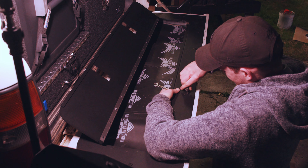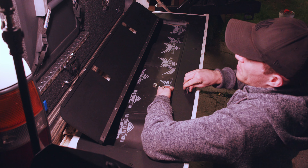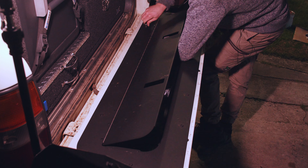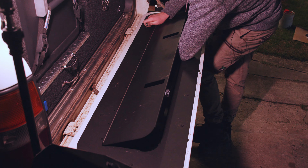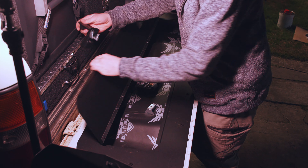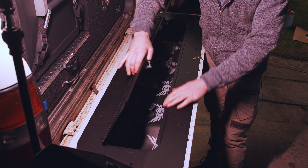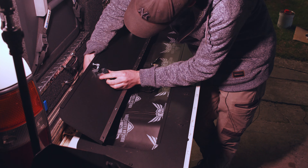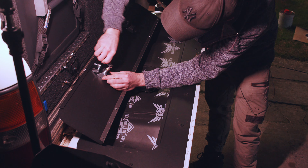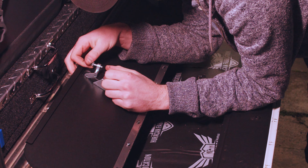These are pretty hard to access - I'm having to sit the nut at the very edge of my fingers. What I've done is take this out, look through the hole, and I can see I've lined up the nut, so I'm just going to twist that in now. That's hit the nylon seal. This is the much harder section through here because it's awkward to get to. Just so you know, it's a 13mm nut so you need a 13mm spanner - a little quarter-inch ratchet kit works well. You sit that on one side, put the bolt through the other, put the bolt back in, and Bob's your uncle.